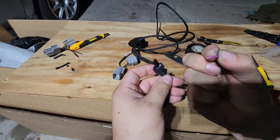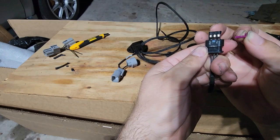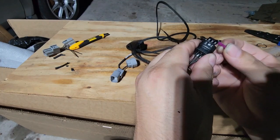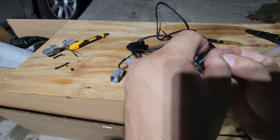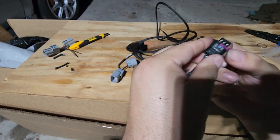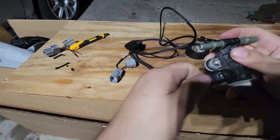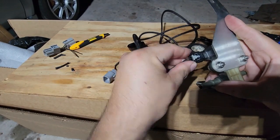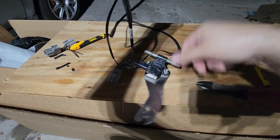Don't forget the little purple lock — it ensures the pins cannot be removed. The only way to remove them would be to take out the lock and use a de-pinning tool. I slide it in from the side and it locks in place. This extra lock slides forward once inserted and locks everything — you can't pull the pin. We're good to go, and the sensor is now converted over to the new style connector.